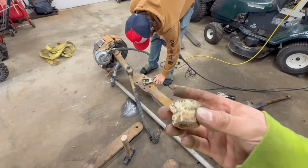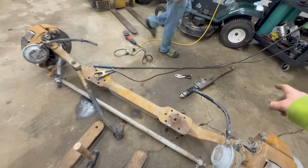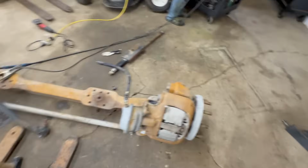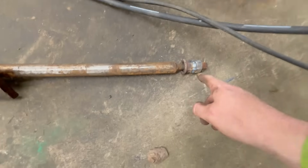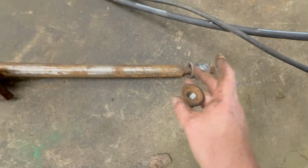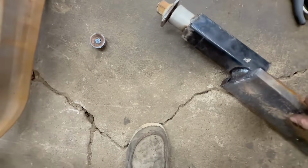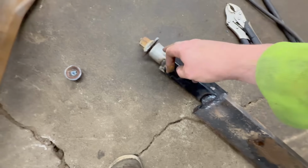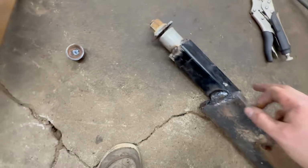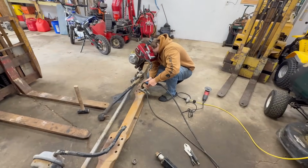So we take the lug nuts and we put them on upside down and weld the lug nut to that nut. And then we took our homemade slide hammer, because this was from a skid steer he doesn't have anymore. And then we thread the new nut that we welded on top of that one onto this rod. And then we took our homemade slide hammer, giant counterweight of just a big thick piece with a square tubing and a little round thing. It's just scrap metal he had laying around. Built a big washer, put a nut on top, a couple hits and she was out. There again. Hopefully that side goes just as easy.